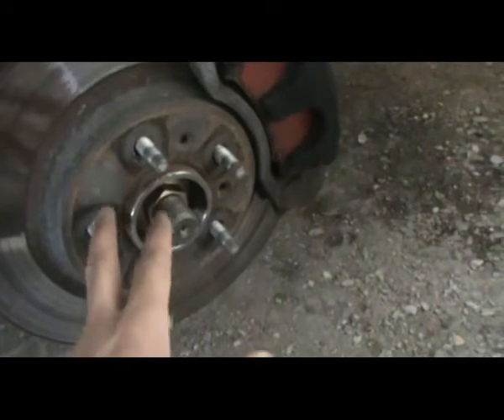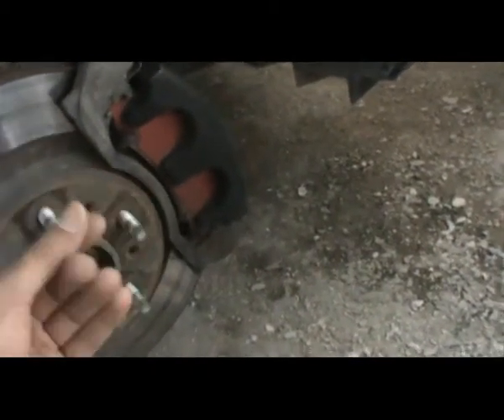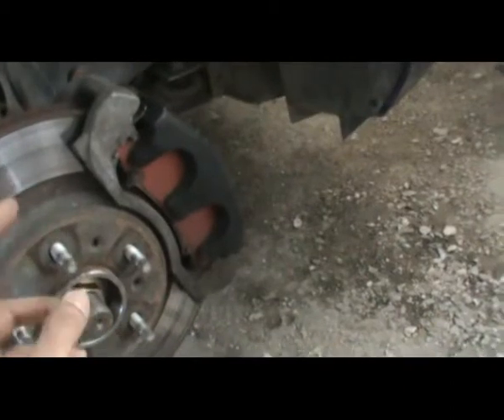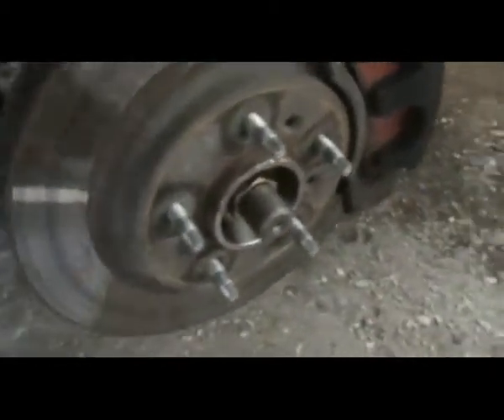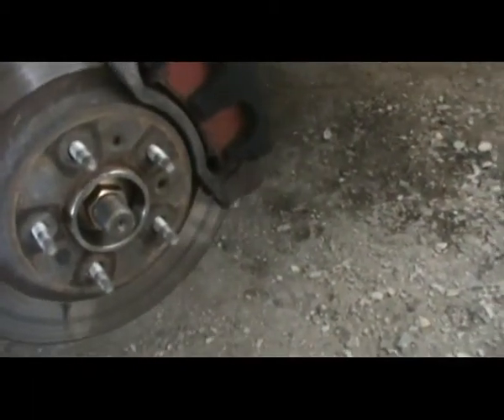So if there's snow or rain and you hit the brake hard and the tire locks, but the other tire is still spinning, the car knows that tire locked and releases the brake — clamping and releasing many times per second. That's how the ABS works, preventing your tire from locking until all four tires come to a complete stop. So that's what this wire does — the sensor cannot detect any rotation from this tire, which is why it says traction, ABS, brake assist — none of it works.